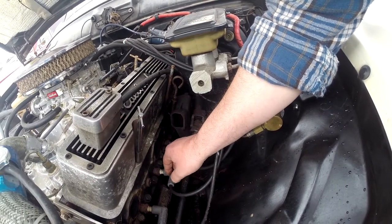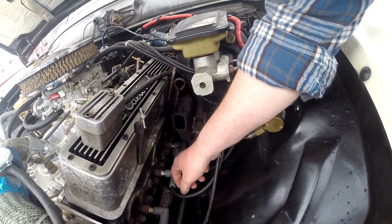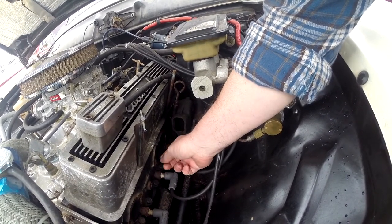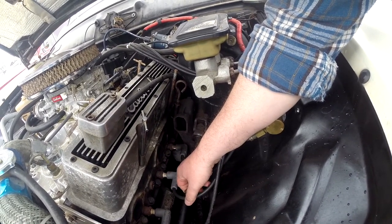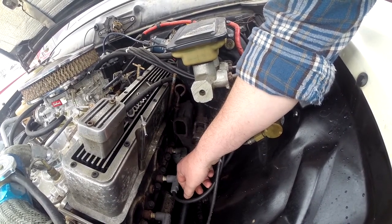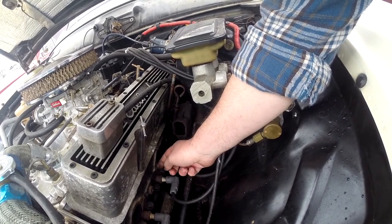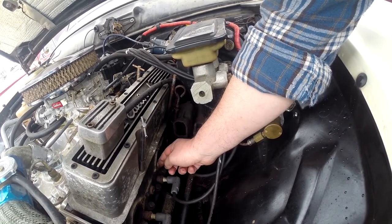I soaked them with some penetrant and left it overnight and they came out quite easily. The last major exhaust manifold extraction I had to do on the Dodge truck took way too long — partly because I twisted the head right off the bolt and they were all rusted in. What happens is the bolts rust to the manifold, which rusts to the engine block, all being iron in this case.